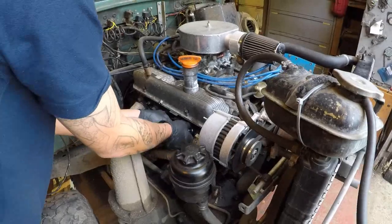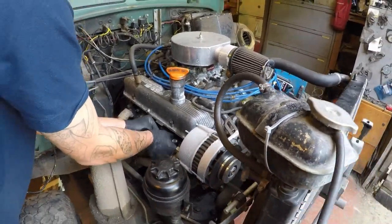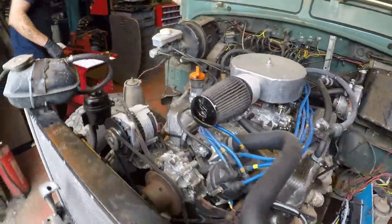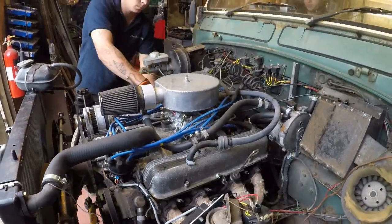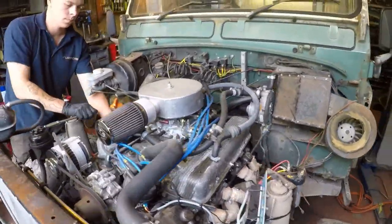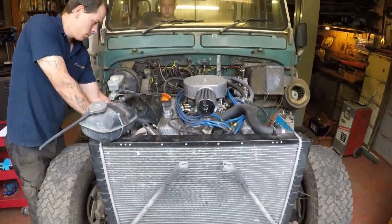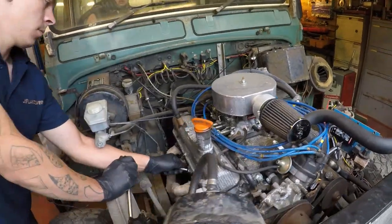Just put the spark plug back in — you don't need to do it very tight, just tight enough. It's only the transfer of gas between cylinders you want to detect, and then we'll do another compression test. Another good tip about having the battery on there is the engine will crank slightly faster, maintaining oil around the system, which is very important when you're doing this.